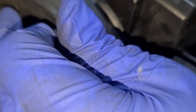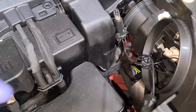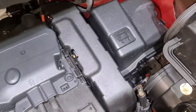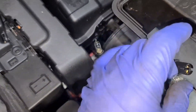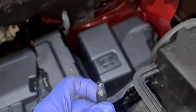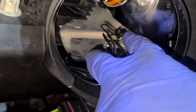Put the cover back on, then switch the lights off — make sure you don't damage anything. As I'm on my own it's going to be a bit difficult. So pull this bulb out — here's the 501 bulb. Got the new one in my hand already, so I'm going to replace it, slot it in. Then slot it through the hole right there and push it in until it clicks.